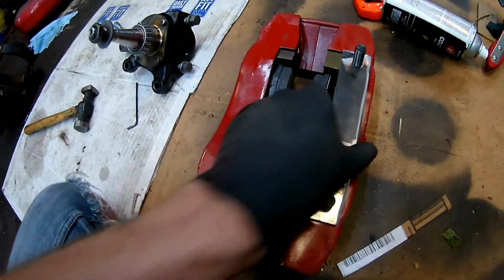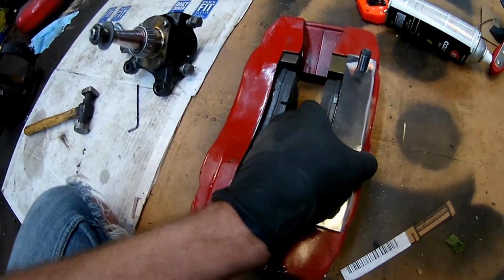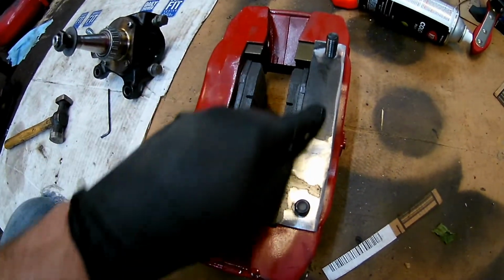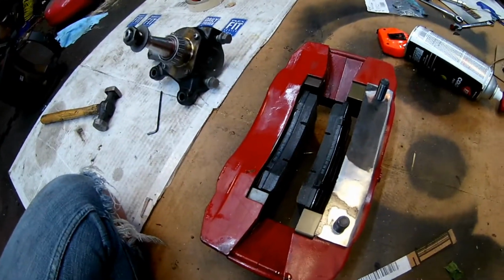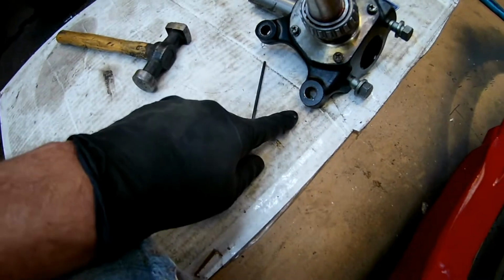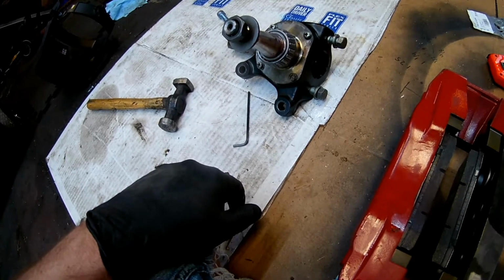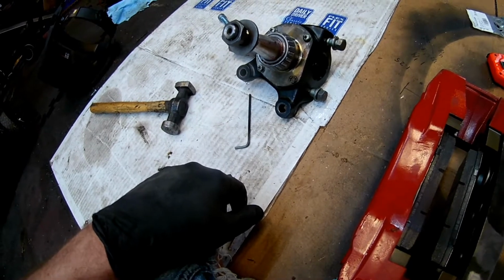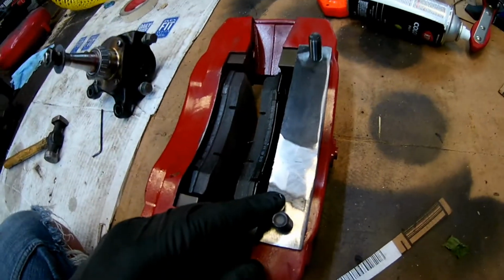So what I've done is I'm using 3/8 steel, which is probably overkill, but I'm not going to be ever worried about it either. Made this portion of the bracket. Then there's another portion of the bracket that is bolted to the spindle, to this part, and then once you get those placed up there, you do a little tinkering around with exactly where you want the placement to be, and then you burn a couple strong tacks in there and then weld it up. So these sound simple, right? But